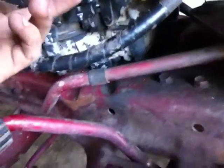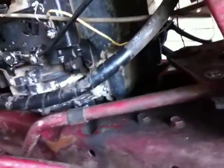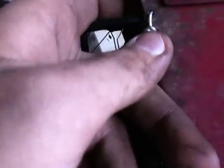I don't know if you can see it right there. That little hook right there caught this bike cable and pulled it. And I was like, oh, if I forget that's there and it dangles down there and I whip this forward, that's going to break my bike cable and my gas pedal, and then I'm going to be stranded stuck somewhere. So I drilled two little holes right here, ran some electric fence wire up in there, and then tied this cable up so that it doesn't go anywhere. Yep, that's how I did that.